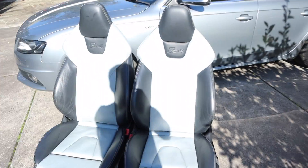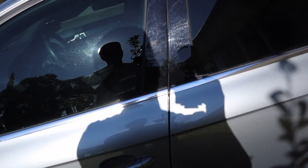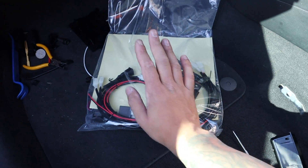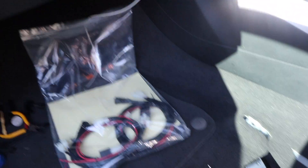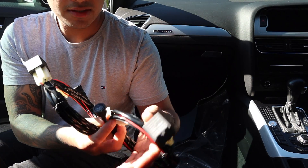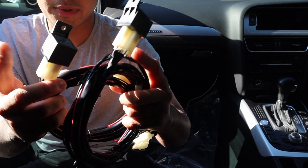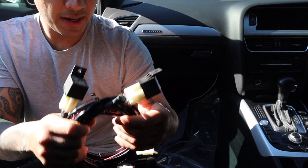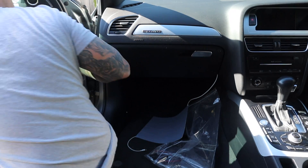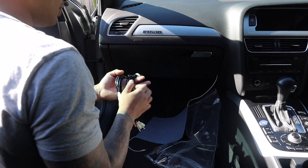We have the seats completed — they were pretty difficult but not too bad — and all we have to do now is the wiring. In here we have some wiring, so we'll go through exactly what we have and how it's done, run that to our seats, and then put the seats back in and test it. In our kit we have two wiring harnesses with a switch each. Basically we connect this to the fuse box. This is a little relay — the switch flicks the relay, which sends power to each heated mat. These get connected together at the fuse box, then we run one set of plugs to the passenger side and one set to the driver's side.